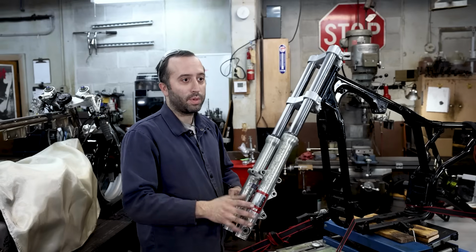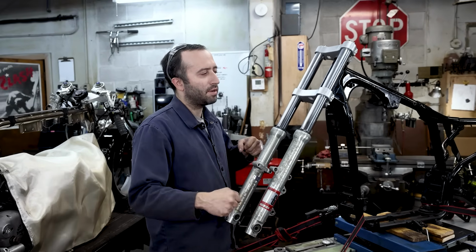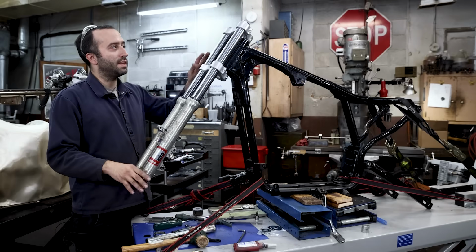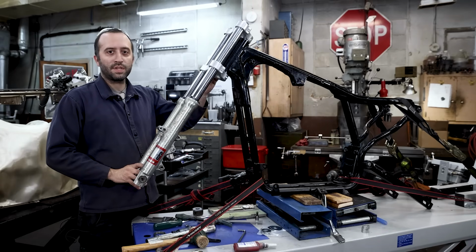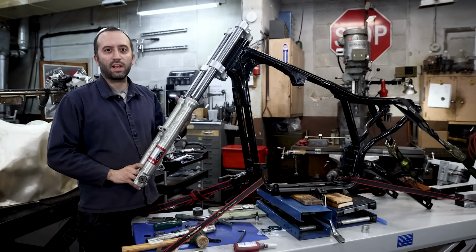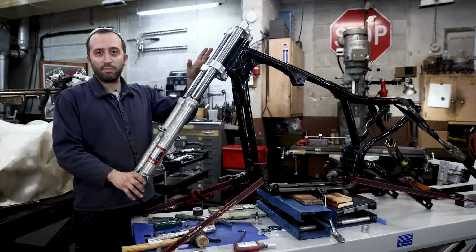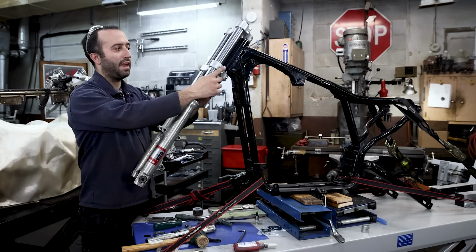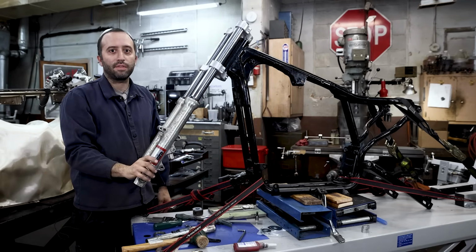And like I said, when you put a wheel on here and stuff, it'll still be loose and you'll be able to turn this easily, but it'll be just a little stiff, and that's how I like to set them up. After you get it adjusted the way you want, you're going to lock down all the pinch bolts. The Harley manual recommends 30 to 35 foot-pounds. These are custom trees, and we recommend that you torque them to 30 foot-pounds. So get out your torque wrench and all the pinch bolts on the tubes and on the stem, torque them all down to 30 foot-pounds.